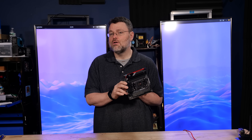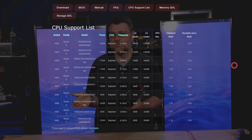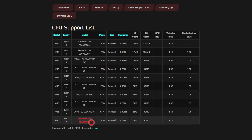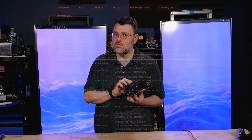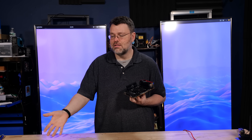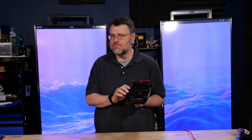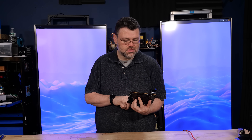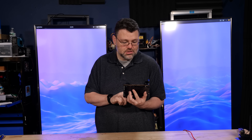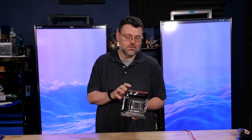For this feature set, it's a relatively no-frills motherboard. It does not have a BIOS flashback function, so you want to make sure the box and manual shows support for the CPU you intend to run. The 7800X3D chips just launched, and this motherboard posted and supported the 7800X3D out of the box. Without BIOS flashback, it might have been necessary to borrow a friend's CPU or go to a local computer shop to update the BIOS. It's frankly a baffling omission, given that AMD supports it even on B650 chipsets — none of the USB ports are marked for BIOS flashback either.